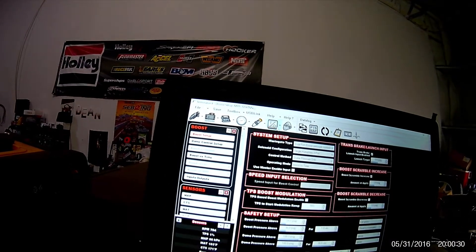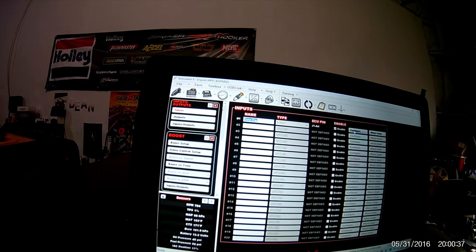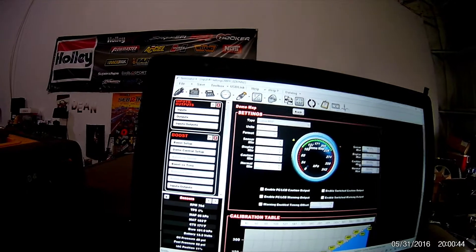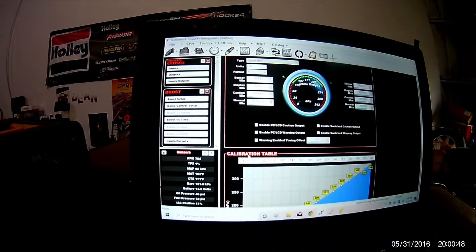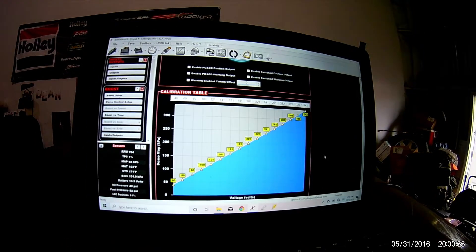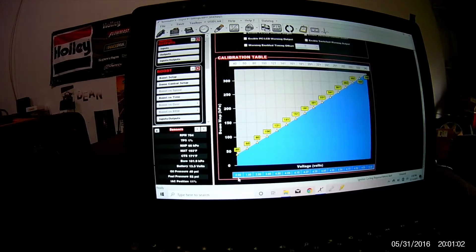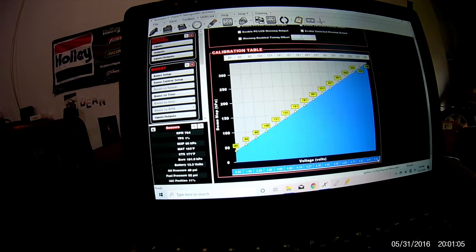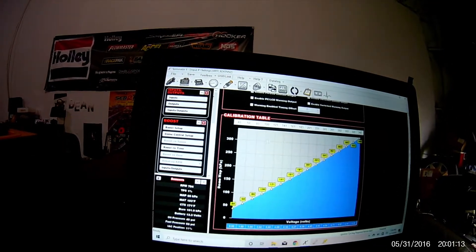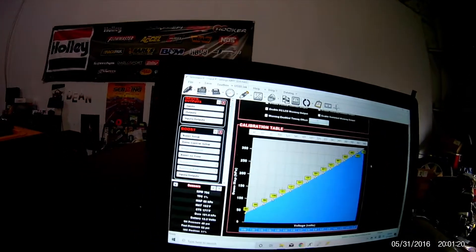He plotted out the dome map with five volts and then configured it for his MAP sensor — which I did the same thing. I configured it for my MAP sensor: zero volts is 40, five volts is 342. I did have to change the bottom voltage from zero to five. I went to the end, put in five, did Fill Table and Fill Row — selected them all and it was done. Same thing for the top: 342 and 40, selected them, did Fill Row, and it puts it all in there — almost like an interpolate on most other systems.